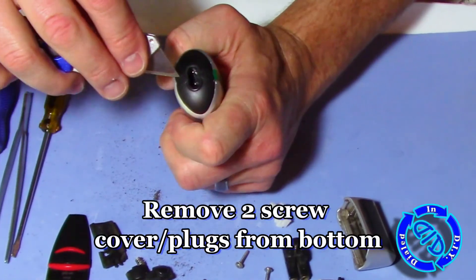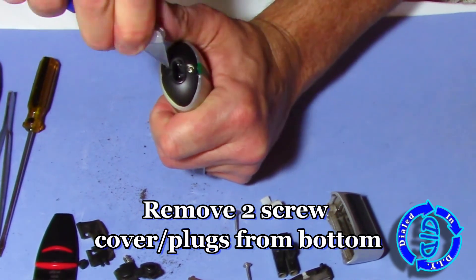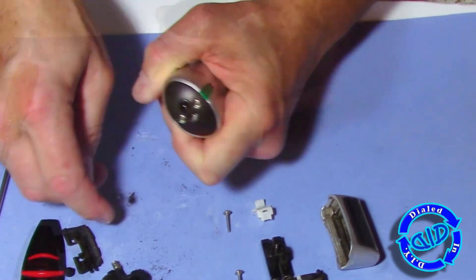When you look at the bottom side of a razor like this, you're going to know that right around the area where the power cord plugs in, there are these little screw hole covers. We've got to take these out so we can get to the screws, remove them, and then pry off the rest of the bottom part and get to the inside better parts like the motor.